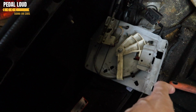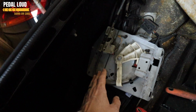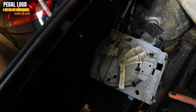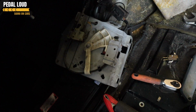And then what you can do is, with your sunroof cogs detached and taken out, what we did was we took the encasings out and replaced them with the brass ones. You've got this set up in this position, that's point number 1. Then what you need to do is get the sunroof arms in their lowest position, or get one in their lowest position. Don't bolt everything up yet. In fact, we'll show you that now.